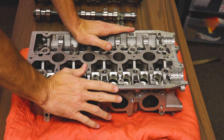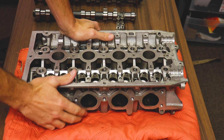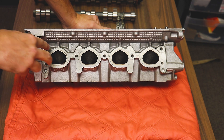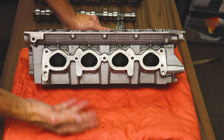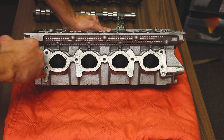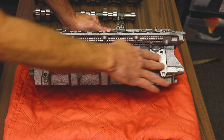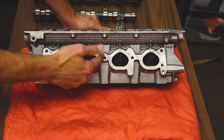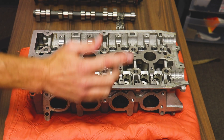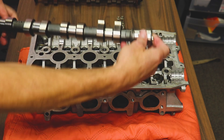Let me go into a little bit about the difference between the US market cylinder heads and the cylinder heads over in the UK. Some of the main differences are the bolt pattern on the intake — the intake bolt pattern is different. I'll toss a picture here of the difference. There's a bolt here, here, and also here. It's just different, and that not only extends from the intake side of things, but also how this thing is machined along with these camshafts.